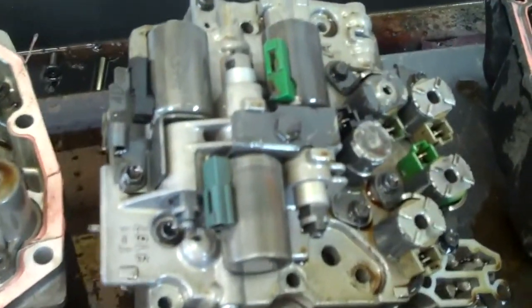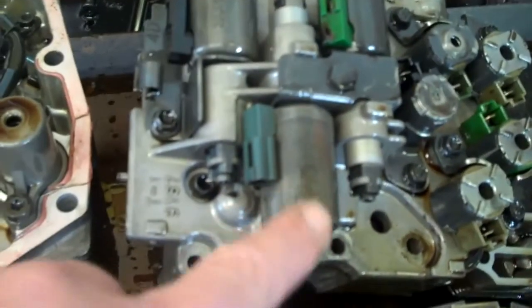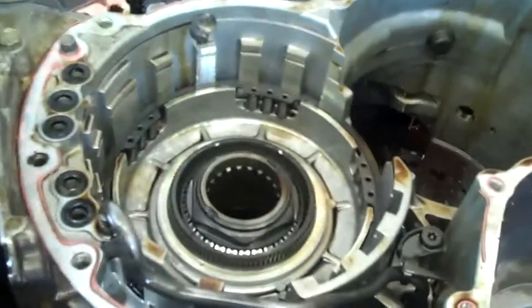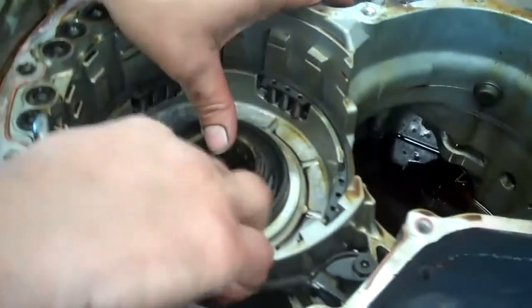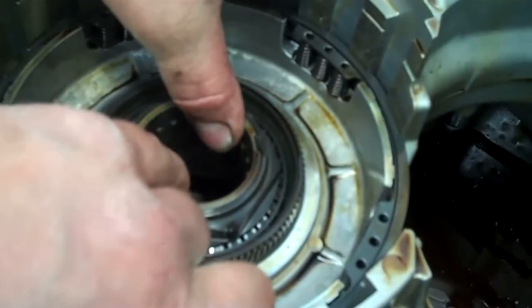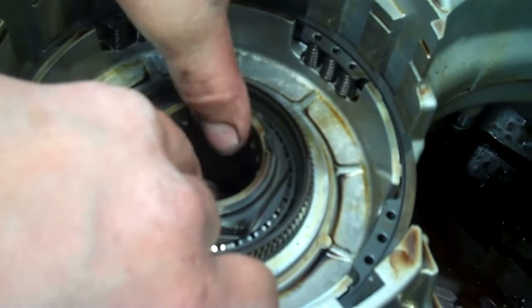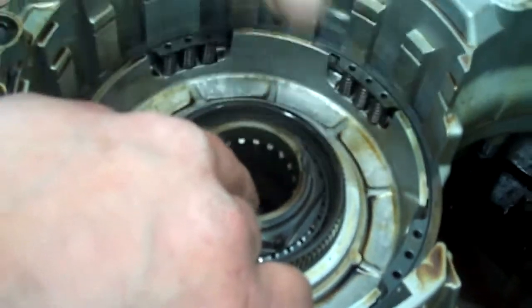Because the fluid was contaminated with the particles, those solenoids need to be rebuilt — the electronics inside these units right here. You're not going to be able to see it very well, but this does wobble. Carl's going to help me a little bit here — there is a wobble there, meaning your case has some problems right in the housing itself. There's enough wobble in there to be a major concern.